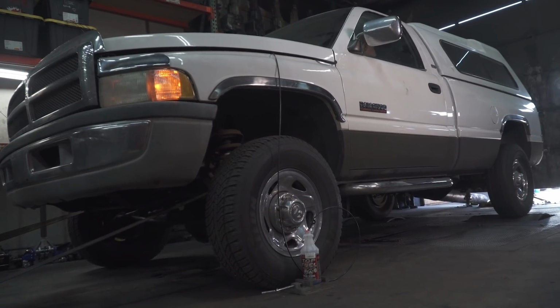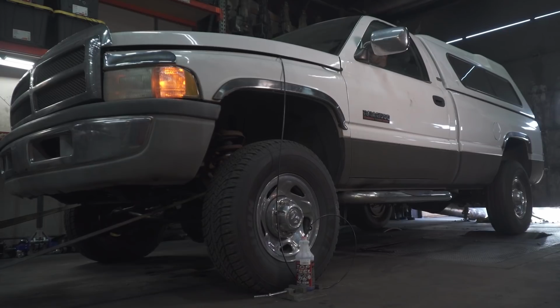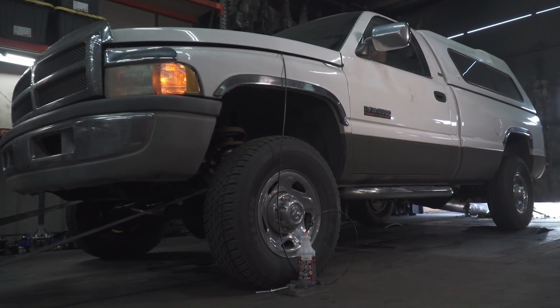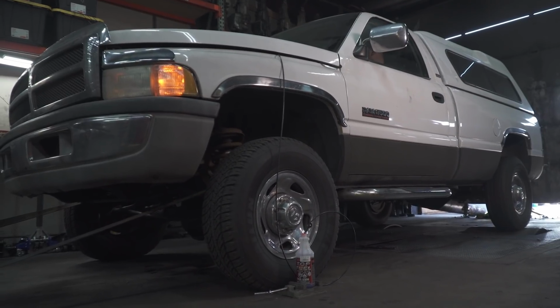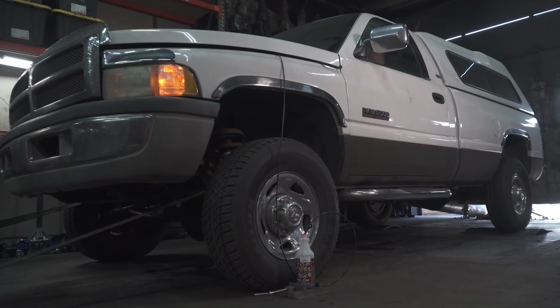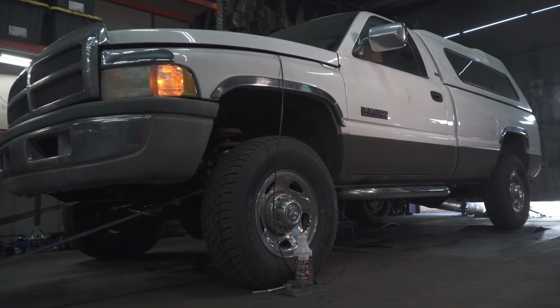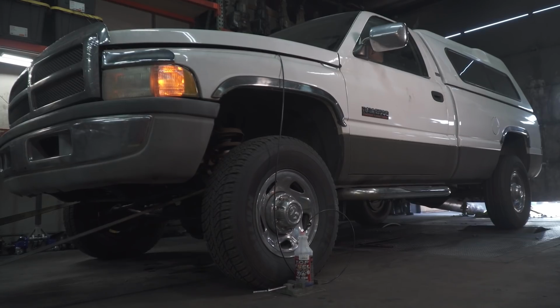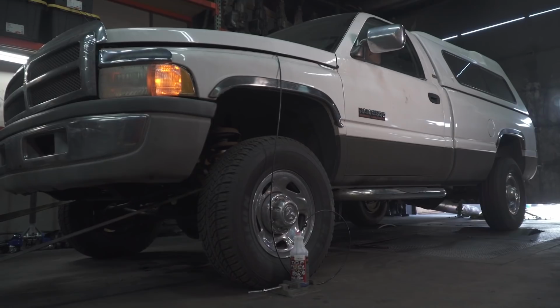Crazy. Max power mode engaged. You're going to come in at 20 pounds of boost like before with the special sauce on the button. Okay, I'm at third gear, overdrive. Now I've locked the converter. 1500 RPM roughly. Or coast down to 1360. And I'm just going to get it and hopefully she don't blow up.